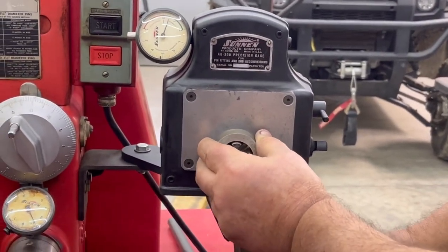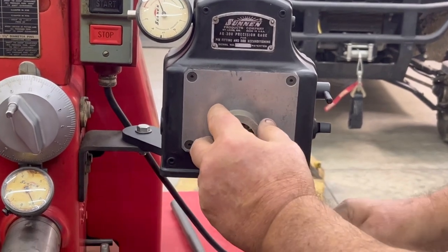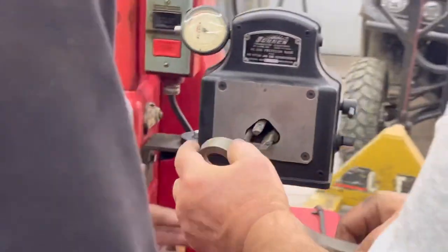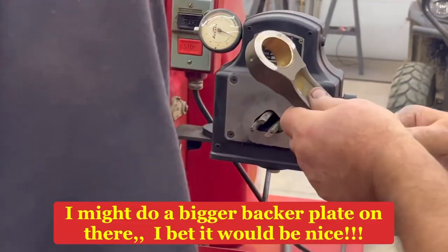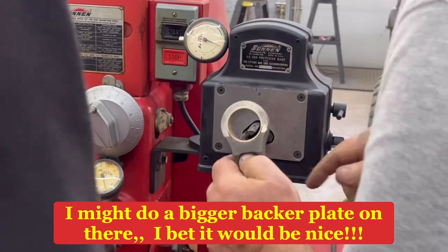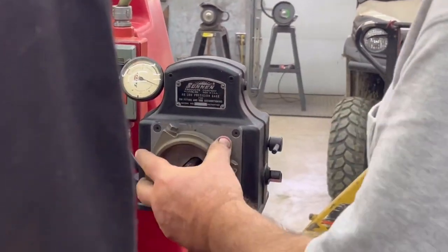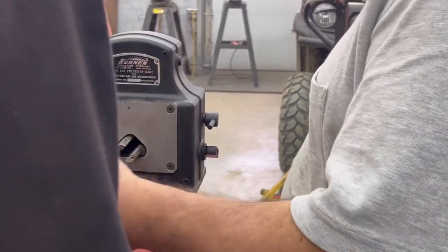And being angled rods like that, it's hard to get it. Yeah, maybe I should have just something bigger on it. Maybe. No, it's the nature of the beast. I mean, you could use bore gauges and all that, but you see where your contact points are. And they're doing a big end of the rod. You're up against the face, yeah. But you're not on that pin end.